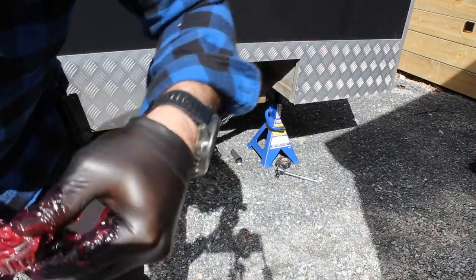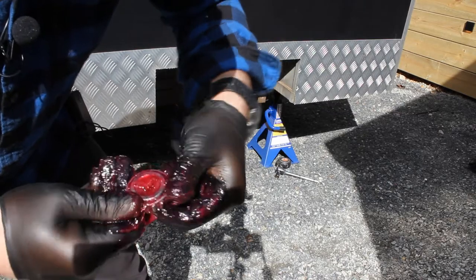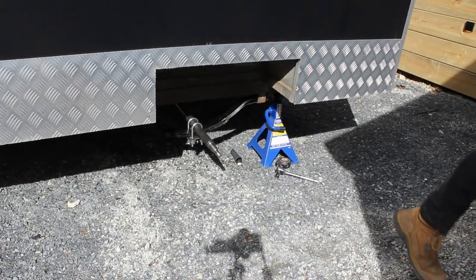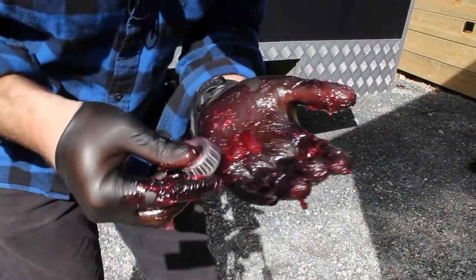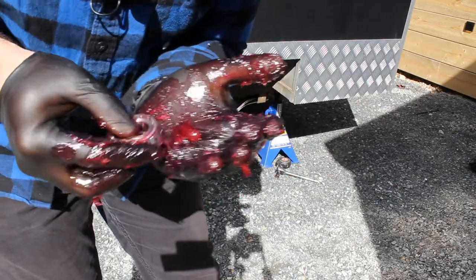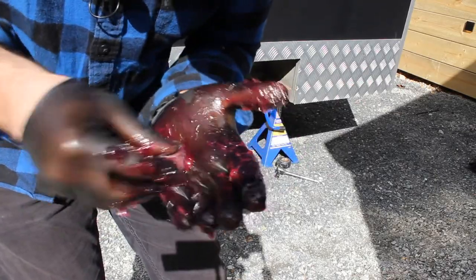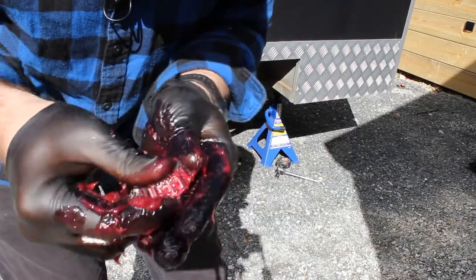With these ones, you can even just push it through with your thumb, just like that. Just making sure you get lots of grease in there. But important to choose, when you're doing this kind of thing, is make sure you're using the right quality grease. Don't cheap out on grease. Grease is cheap. Bearings, when you've got to replace them, is not cheap. Or when your hub falls off the side of your trailer going down the freeway, that's not cheap. Don't be tight with these.